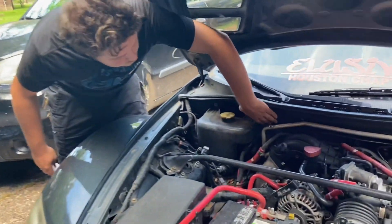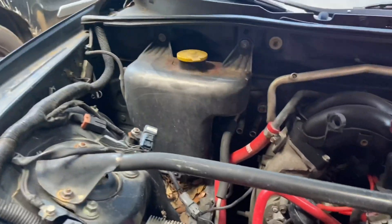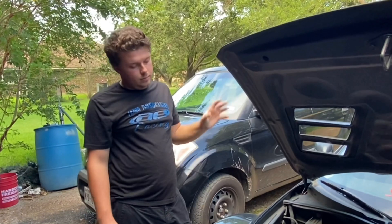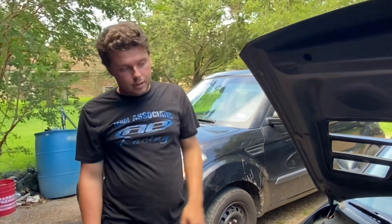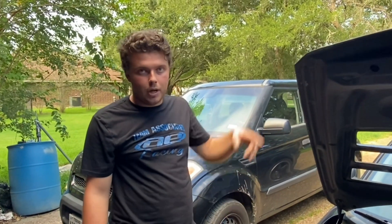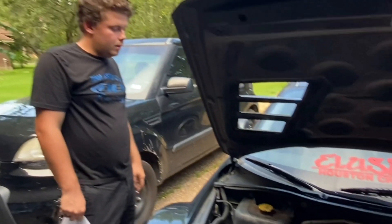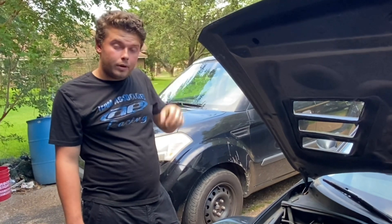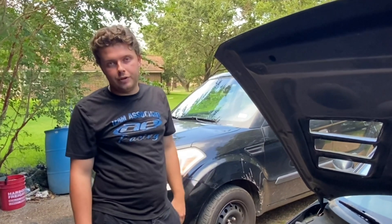The heater core is back in the firewall, behind the dash inside the car. There are two nipples that come from it right here, but mine are disconnected because my heater core is broken and leaks. So I bypassed it — just hooked the lines so coolant goes through the block and the lines but doesn't actually flow through the heater core. That affects the heater since it won't get hot anymore, but it's a temporary fix until I feel like doing the full heater core replacement, which is a big job.